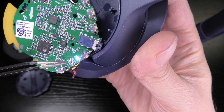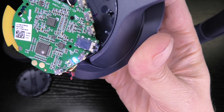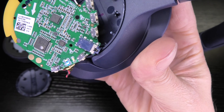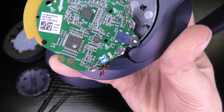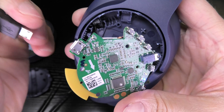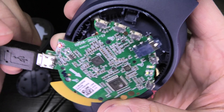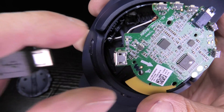The white LED is for the power switch, and to the right of it in blue is for the active noise cancellation — actually it's a white LED for ANC. When you press that button to turn off ANC, it also disables that LED. The blinking blue LED means the headphones are currently in pairing mode. On the opposite side of the board there's the charging port — when you connect the micro USB cable and the battery is charging, a red LED lights up.